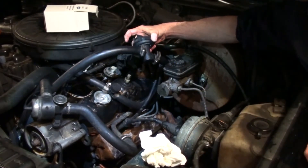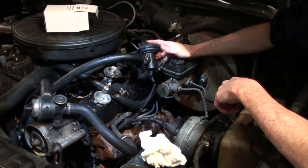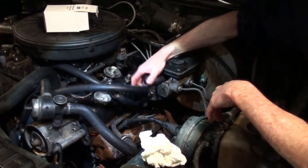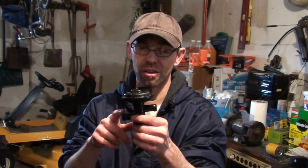The new heater control valve is now in place. Make sure that you put your vacuum line back on, and that should help you out. You should have heat in your vehicle and stay nice and cozy during the winter. So there you have it — your replaced heater control valve. It's pretty simple: you got an inlet hose, you got an outlet hose, put them on, tighten the bands, let the antifreeze flow through there, and get some heat during the winter.